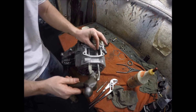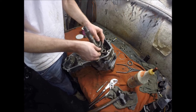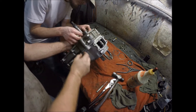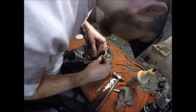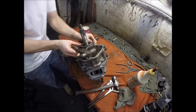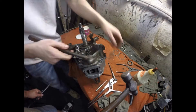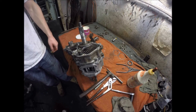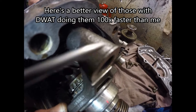Is that where you can get that started? There you go. Hold that in place and come back here. So now we want to come all the way back, pull this back towards you, then line up for the roll pin and install the roll pin. Are you kidding me? I think that's the most tools I've ever seen for installing one roll pin. That was good — the other one was easy. This one on the second fork is the one we're about to do.